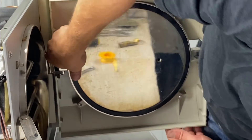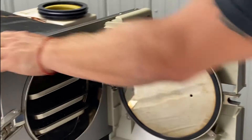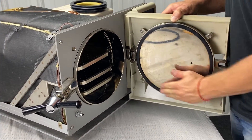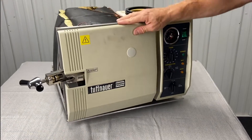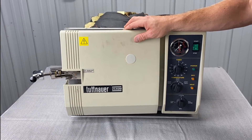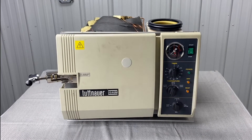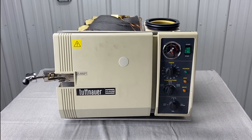You can use a screwdriver or spatula, but you run the risk of scoring the gasket. That's how you replace the gasket — as you can see, we're in all the way. Visually inspect it and make sure you've got nothing sticking out. You will run into little lumps — smooth them out by pushing in and wiping around. We just did the annual preventative maintenance kit replacement for a 2540. They are all the same way to do it, except the gaskets are different sizes. The 220 units — like the 2540 MK — have the red air jet. If you like this video, please share it, subscribe to our channel, and stay tuned for more troubleshooting videos. Thank you.